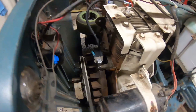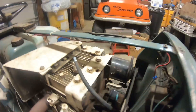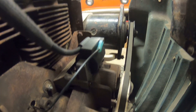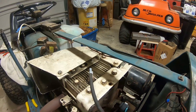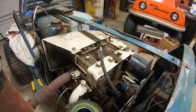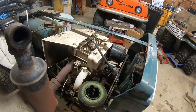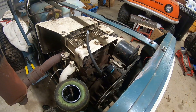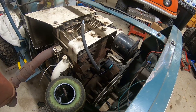I'm going to try it anyway. On the housing on the other side it says 'out' - you know, that means out, away from the engine, away from the cylinder. I got spark out of it. I took the plug out, laid it down, looked at the plug as I turned it over, and she was sparking. But it would not start no matter what I did - put a little gas in, a little ether spray - would not start. So off to the internet, thank god for YouTube. I found a guy that said just turn the coil around - apparently they say 'out' but it's really supposed to be 'in.'